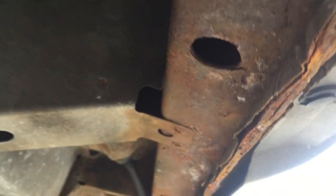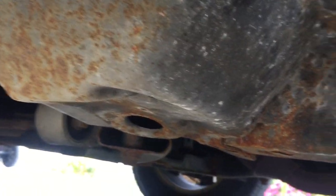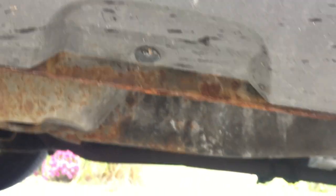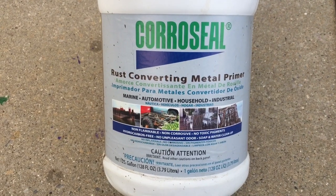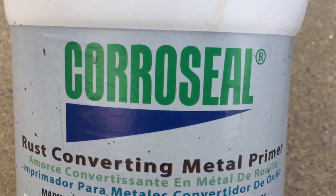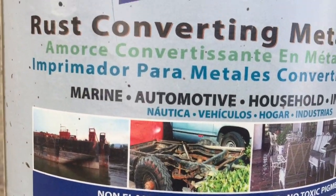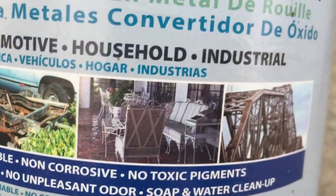It just doesn't hold up. The reason why I keep using this Coraceal is because I have a big giant jug of it. At the time I bought it, it made sense to buy the big one for the price — I was welding a bunch of new body panels into one of my vehicles, the Jeep. I coated all the new clean metal and welds with Coraceal before I painted it to prevent rust. Since then, that vehicle is only driven in the summertime on nice days — it has not seen any rain, snow, or cold weather — and there's rust coming through on the welds. So that's why I have the big jug, and now I'm stuck with it, so I just keep using it.